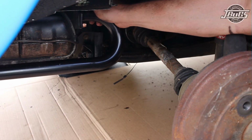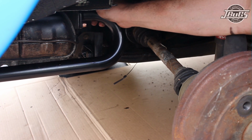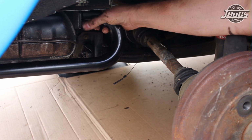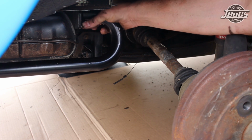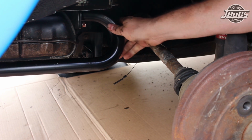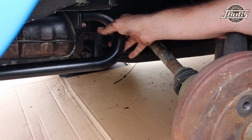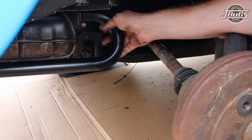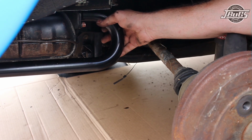And anytime you're fitting an exhaust, until you get everything attached, the heater boxes or J-tubes, the new exhaust pipe, muffler or header or what have you, put everything on loosely, get everything test fit, make certain all the pipes are snug together, J-tubes into the header, etc., before going through and tightening all your exhaust nuts.